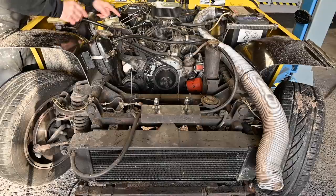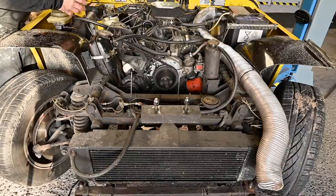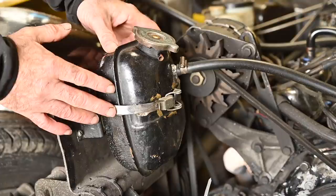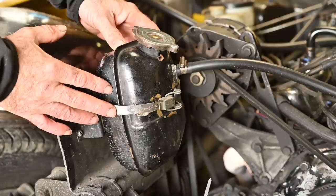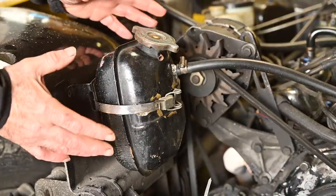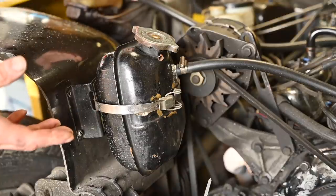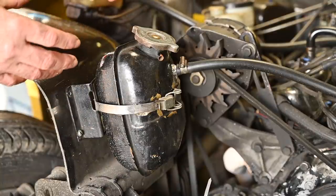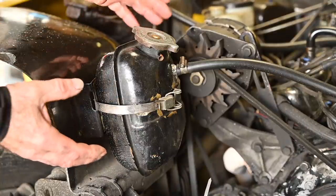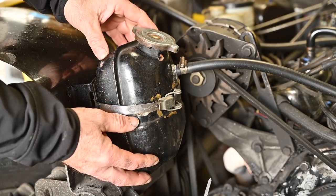Water flows through the radiator, comes back out the bottom, and is fed back into the water pump, which then pushes it into the engine block. There's also an extra hose in the back going to your heating compartment for the driver's area. The overflow tank on the left contains excess cooling liquid — whenever the cooling liquid gets hot it expands, and to compensate for this expansion and the shrinkage when it cools, we need to catch that variation, which is why we have this overflow tank.